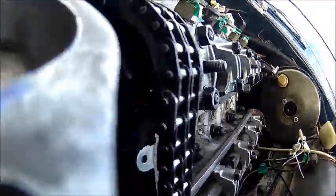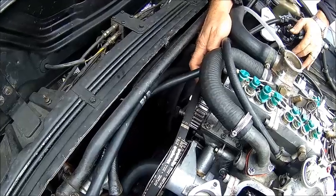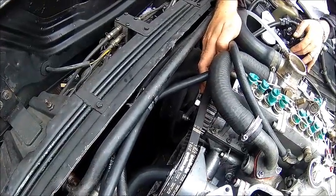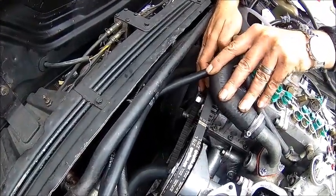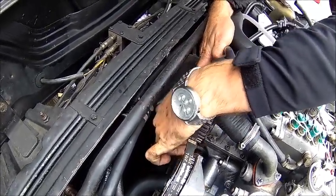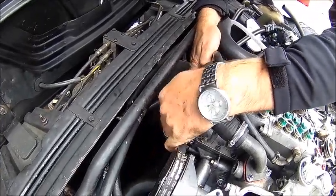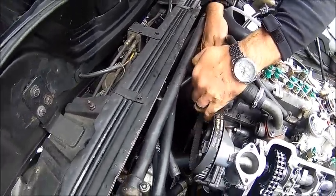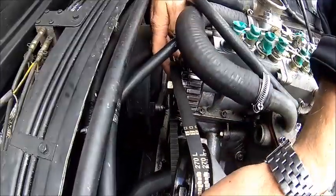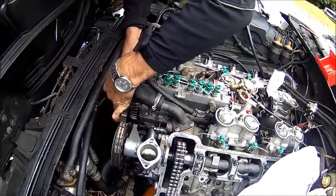Make sure you put the link in the right direction. The drive belt is a bit weird — there's no tensioner, so you're going to have to fiddle it over the pulley somehow. Make sure you've got the right timing marks. That's probably the reason why it's machined down here, otherwise you're not going to get it over, because half of the pulley is machined away. It's a bit fiddly, but it's doable.